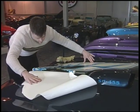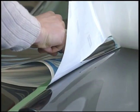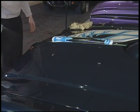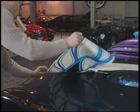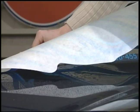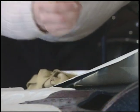Now we can peel the decal away from the backing — it's ready to be applied to the hood, but first we'll have to trim away the backing. Then you're going to spray it with a solution: 50% alcohol, 50% water, and maybe a drop of dish soap. That'll help promote a slippery surface so you can get rid of all the air pockets. Be careful to lower it down, use a squeegee, and firmly push from the center out to eliminate all the air pockets.